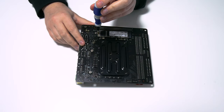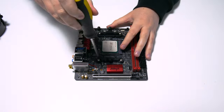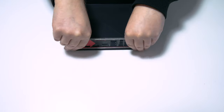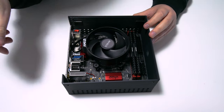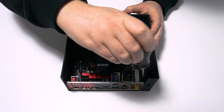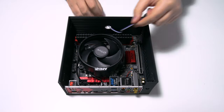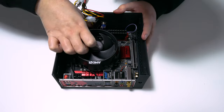The Ryzen 5 2400G is currently the best APU on the market in terms of graphics performance. It doesn't have the performance of a decent discrete graphics card, but at only 65W TDP it opens up the possibility of a small low power PC that's capable of some light 1080p gaming. I went for an NVMe drive due to the better performance than SATA in most cases, while not costing a whole lot more for this model at least, and chose fast 3200MHz RAM because the Ryzen architecture is particularly sensitive to RAM speeds and I wanted to make sure it had decent headroom for gaming.